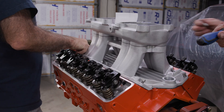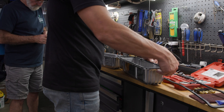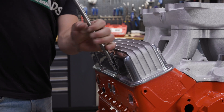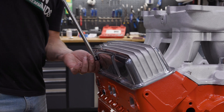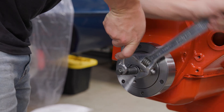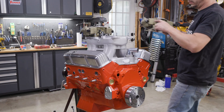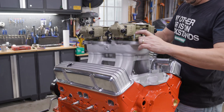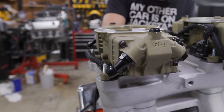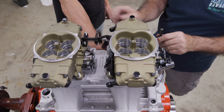There really isn't a more iconic induction setup for a small block Chevy than a tunnel ram. We've got our finned aluminum valve covers on our orange small block Chevy — that's a pretty classic look and it's exactly what we're going for. We installed a Summit SFI balancer because this engine is going to turn a lot of RPM. We decided to go with a Holley Terminator X stealth system. These look like good old-school 4150 Holley double pumper carburetors, but they're actually fuel injection and we're going to be able to tune them. This is going to be a really cool setup that should make a great number on the dyno.